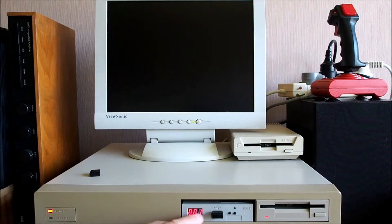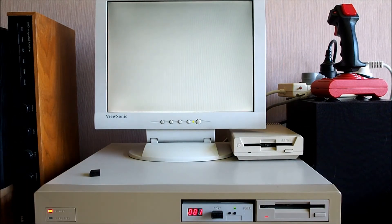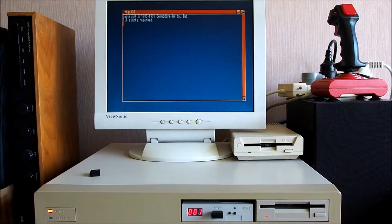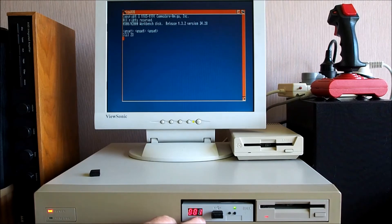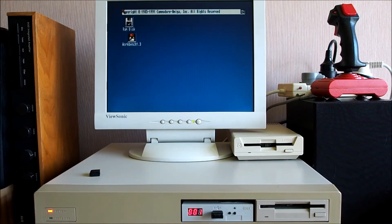After saving, the number counts up to one — that's the default disk selected, which should be the Workbench disc. It loads Workbench 1.3, and once in there it works just like a floppy disk drive. The up and down buttons scroll through the slot list — Workbench is in slot one, and the Extras disc is in slot two. Hitting up effectively ejects the Workbench disc and inserts the Extras disc, just like physically swapping floppy disks.